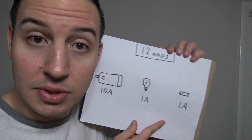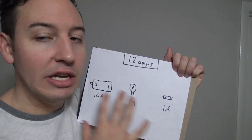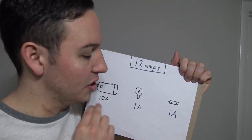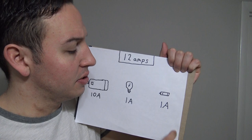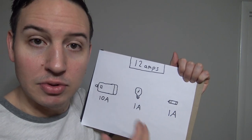So that's it my friends — amps, watts, and volts. In conclusion, remember: volts are always 120 for vacuum cleaners made for U.S. markets. Keep the formulas I gave you so that you can make apples-to-apples comparisons, either watts to watts or amps to amps. And remember, when you use amps, the amp specification is for all the electrical components in the vacuum cleaner, so make sure you're getting just the motor itself — subtract the small motors, light bulbs, and all that kind of stuff to make the apples-to-apples comparison.